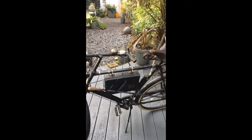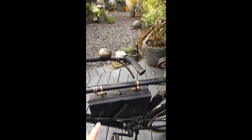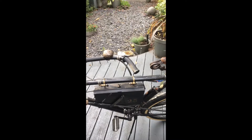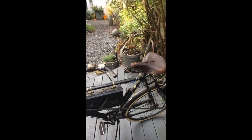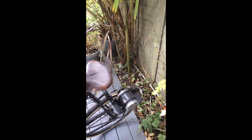It's not something I bought as a kit — it's something I've made from bits and pieces. Here we have the documents box, which houses a 48 volt lithium powered battery, and that's coupled to a graphic equaliser slide, which turns the circular motion of the speed control into a linear motion, which then turns this 750 watt 36 volt motor.